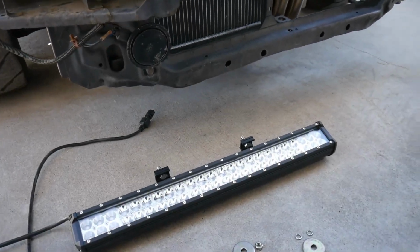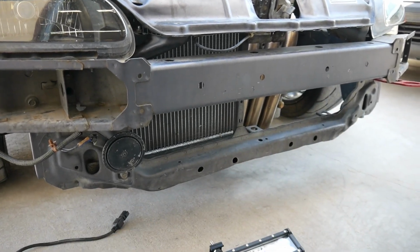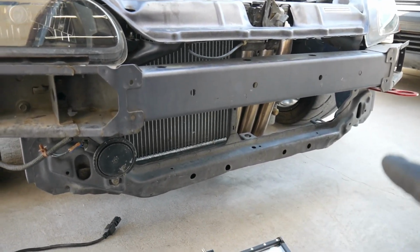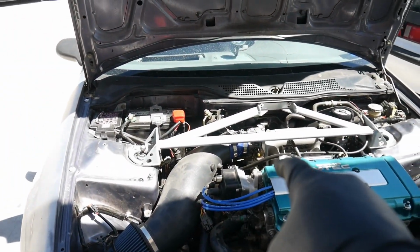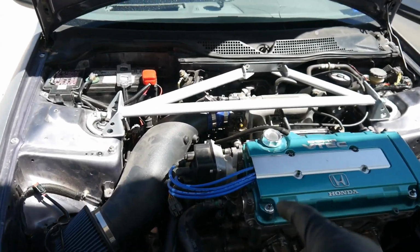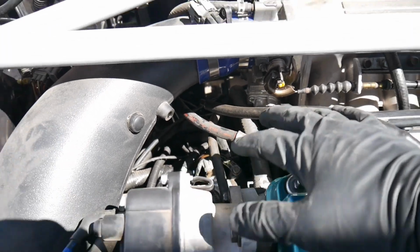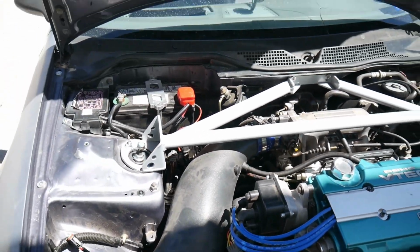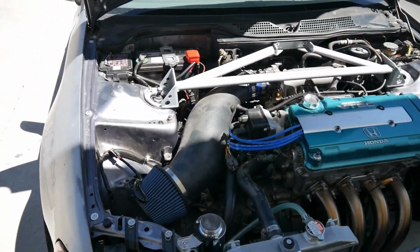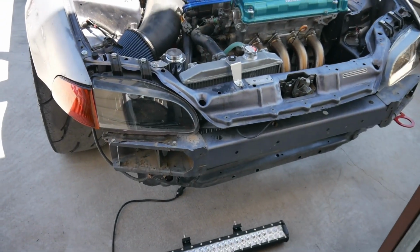So I think the light bar caused a couple of issues with overheating, blocking the majority of the vent. The radiator now had a lot less flow. I ended up removing the bumper, and had an issue with a ground not being, for some reason, the ground that was on the thermostat cover. I had to move it to the actual housing this time and the car started right up. I spent about 45 minutes trying to figure that out. My ECU tested in somebody else's car was okay, but I moved the bumper and took it out for one more session.